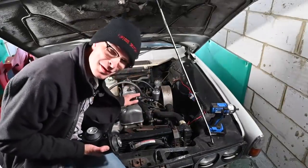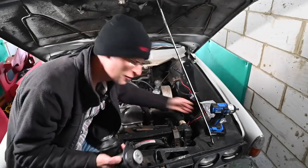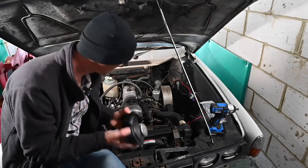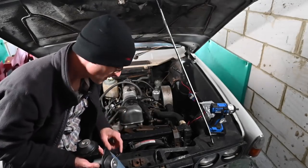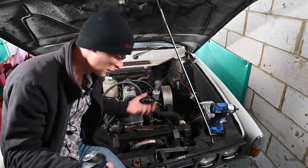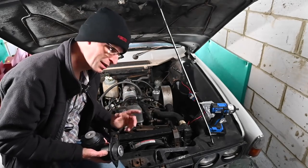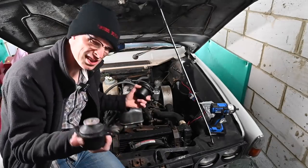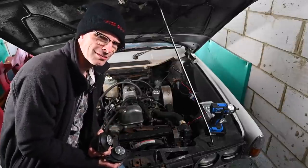Let's roll the thing back a wee bit so I can get to the front. So this is the Rover 2000's engine, these are the new engine mounts and new engine mount bolts. They look significantly different to the old ones that are collapsing in there — those look like little flat donuts, while these are big chunky things. In theory all I need to do is jack the engine carefully from underneath using a big jack and some lumps of wood, take out the old ones, and bolt in the new ones. It's three bolts each side — six bolts total. How long can this take? I'm going to say ten minutes. What could go wrong?